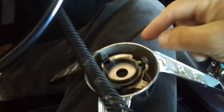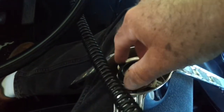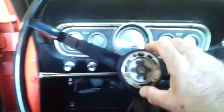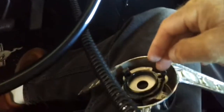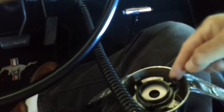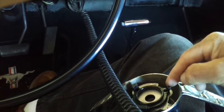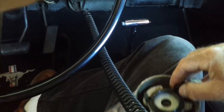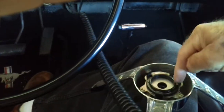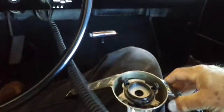The other thing you can have here is this plastic insulated connector that hooks the horn ring to the steering wheel. That could be worn out. Obviously if one of these little hooks — which are made of plastic — is broken, that's a problem. That was the case in my case. One of these was broken. I replaced this whole system and that's about five dollars. It's held on with three screws, so it's a good idea to replace it if you think it's worn out.